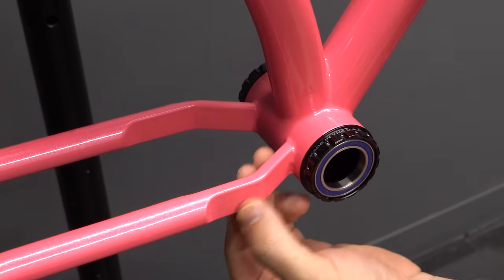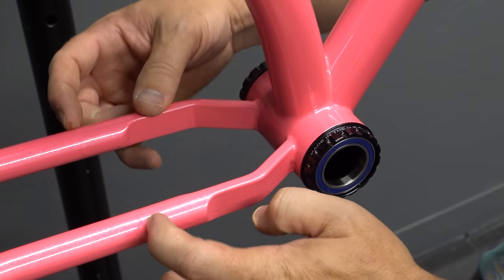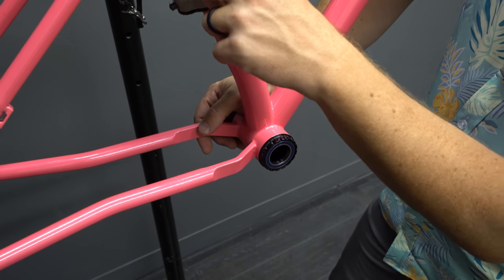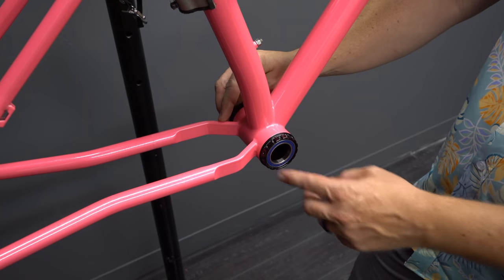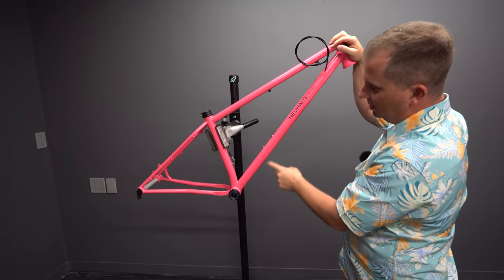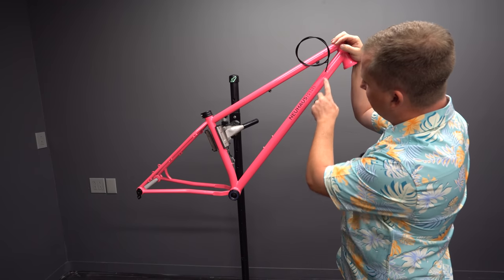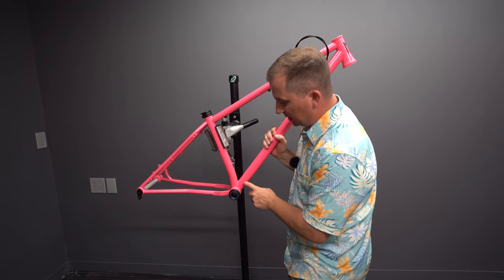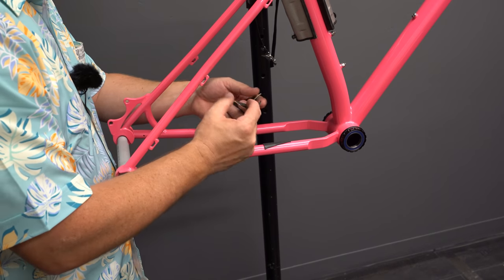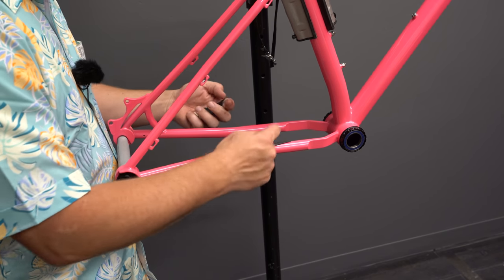In here you can see the really cool clearance for the chainring. I like how these are straight and the tubing didn't connect till here. You can see where the yoke joins the chainstays, and really cool how he's doing that. Here you can see where the seat tube joins — it should give a lot of good clearance in there and still fit some big chainrings. The dropper goes internal here, and because of the bigger T-47, the dropper cable can stay completely internal all the way through. Every other steel frame I've seen has to exit and re-enter, but we're able to just slip it through there. This is mastic tape cut into triangles — the ridges help keep it quiet.